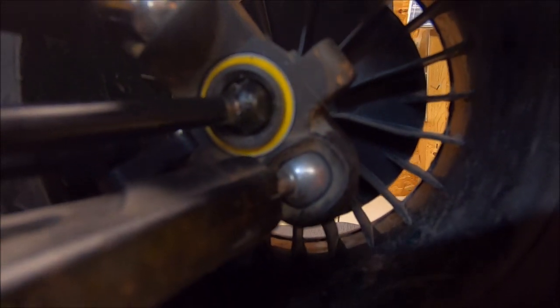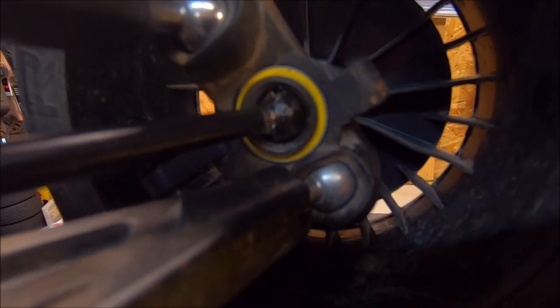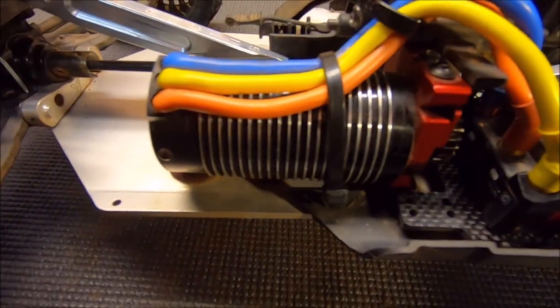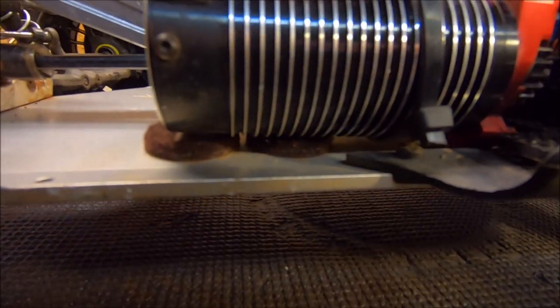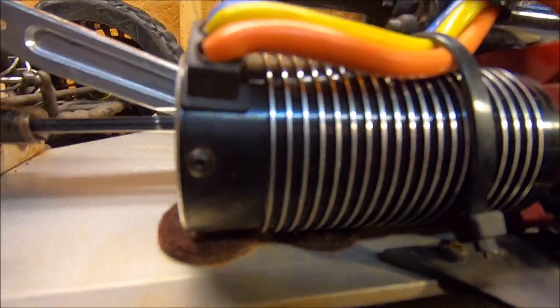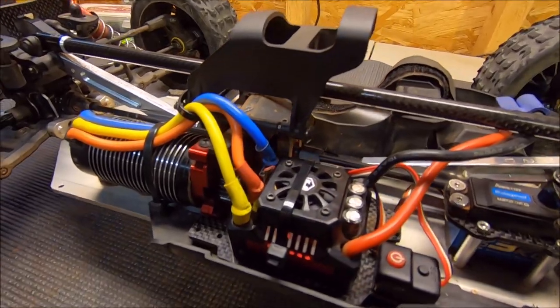These are some butter-smooth bearings. They hold up to a lot of abuse, and being ABEC 5 they're machined very nice to very high tolerances. Pretty cool that they're yellow too, so it matches the yellow body. The truck is running the Max 8 ESC with the Hobby Star 4082 2000KV motor. I've also got some supports back there with felt padding — basically what you use to move furniture — sticks to the chassis and helps support the underside of that motor.